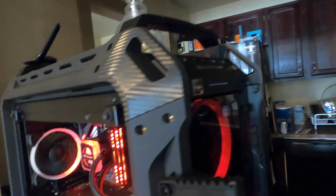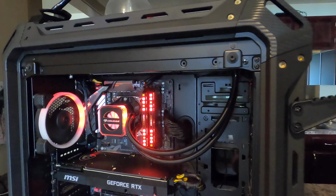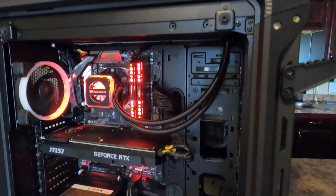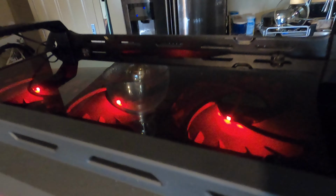This case with cooling, especially radiator support, you can see the big gap between the fans. So you can mount the radiator, but it mounts directly to the frame, to the metal. I just did not like how it mounted up front, which is why I mounted it in the top. Basically, if you mounted it in the front, when you looked at the front, there would be the radiator, and then the fans would be on the inside, because of the fan orientation and the spacing, it just doesn't fit. I think it's kind of a flawed design, honestly. Works good in the front, and then I have the whole front for airflow to cool everything else. But still, taking this off, like I said, you got about a 5 to 7 degrees Celsius CPU improvement, but taking this off in the front, I didn't see any GPU or CPU improvement.